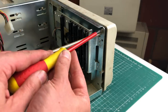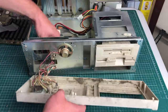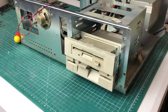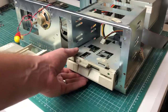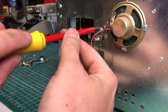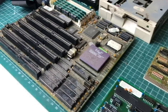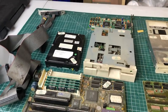Another thing I'm going to remove from this case is the front cover, because that one needs a lot of cleaning both on the outside and the inside — just look at all this dust accumulated on the inside. We'll also need to get the drives out, starting with the five and a quarter inch floppy drive, then the three and a half inch floppy drive. The three and a half inch drive is in a five and a quarter inch bay so it positions nicely on top. As this has an AT-style power supply, we also need to remove the power button as it is directly attached to the PSU.